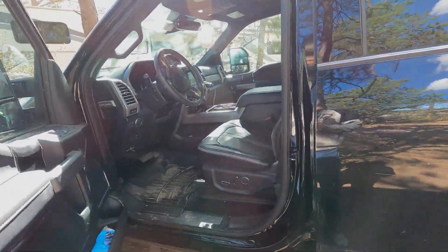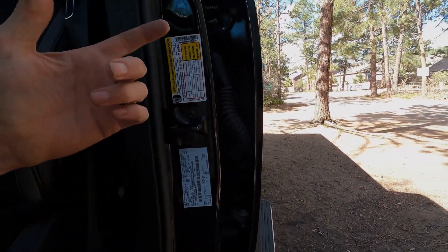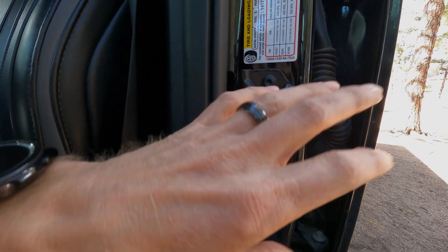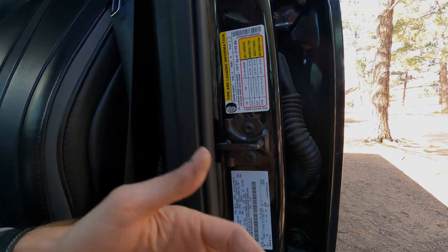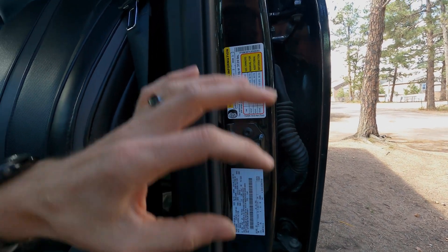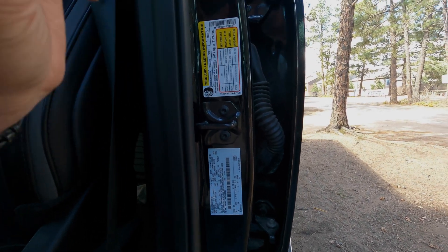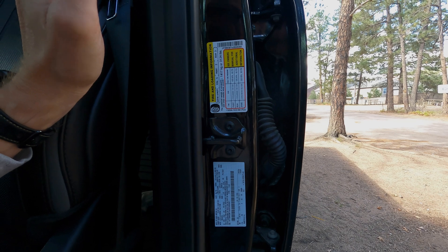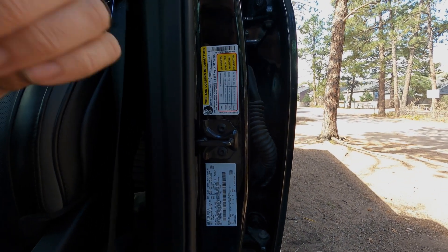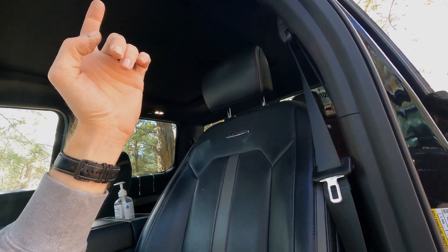The truck we ordered is an F-350 Platinum. We've talked about these numbers a little bit elsewhere, but haven't done an actual video on this channel. There's always a sticker on your vehicle that tells you about the gross axle weight ratings and gross vehicle weight ratings for your particular vehicle. Ford might advertise that an F-350 has a max payload rating of over 7,000 pounds, but that means some specific configuration meets that number — so that best-in-class rating may not be your actual rating. With something like a Platinum, there's a lot of weight in the ceiling because of the full moonroof.